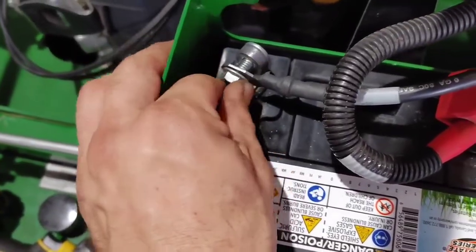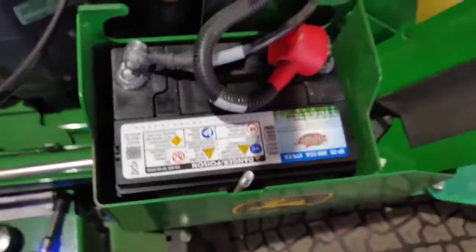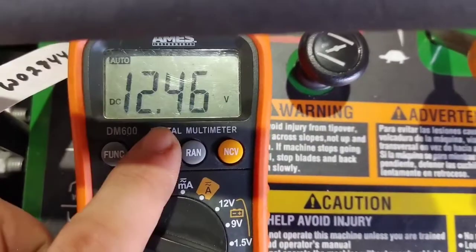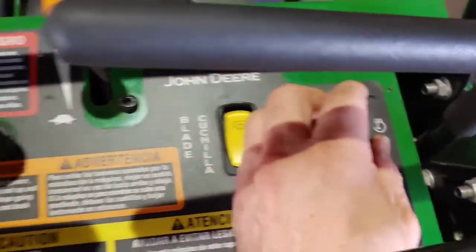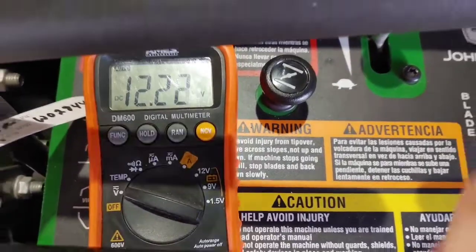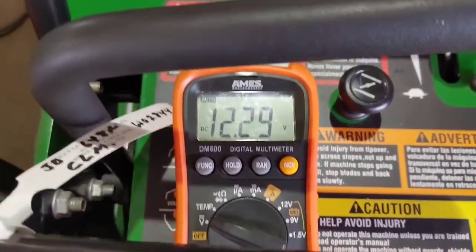When we go to test the battery, you've got to have a fully charged or new battery. Get your voltmeter out, put it on volts DC, and hook it up to the battery. This is a brand new battery. Crank it up — our charging system is not working. You should see 13 to 14 volts at full throttle. I've got it at full throttle now and it's not charging the battery, so I know the charging system is not working.